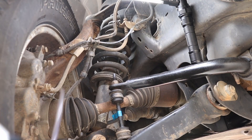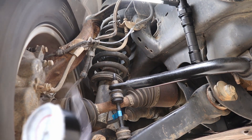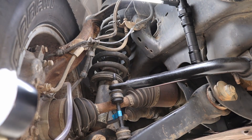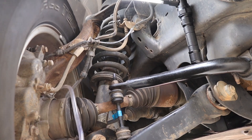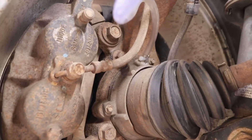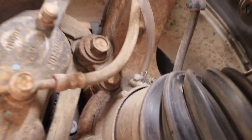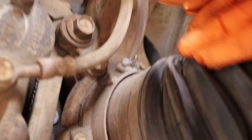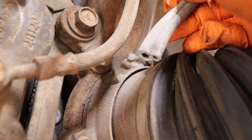If we apply vacuum we'll see that we can turn the wheel without the CV shaft moving. But if we let go and let the air bleed off, then we turn it and you can see the CV shaft moves with it. We have confirmed that the IWE is bad, but I do want to check one more thing just in case my zip tie contraption up there isn't sealing well enough. We'll also check the vacuum coming from this line right here.